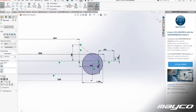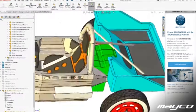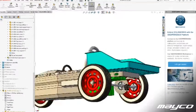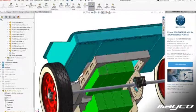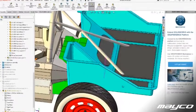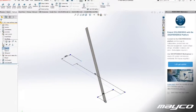Now, ideally with this car, especially because my ultimate goal is also to drift with this car, is to have independent rear suspension. Looking at that, I cannot really find something that I like. So for now, the goal is just to have a little bit like a go-kart rear axle, just a rigid or solid rear axle with a sprocket and a chain drive on one side of the axle and a disc brake on the other side of the axle.